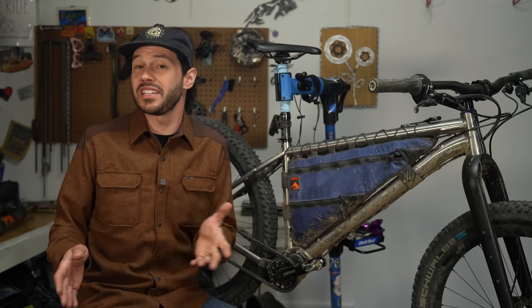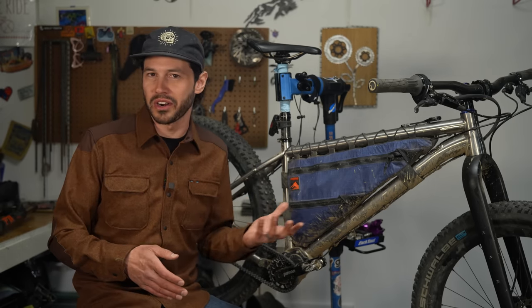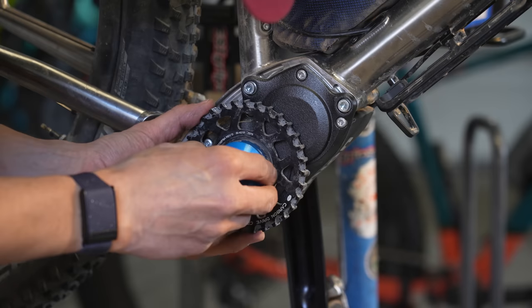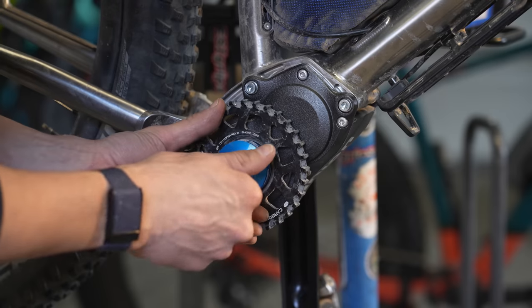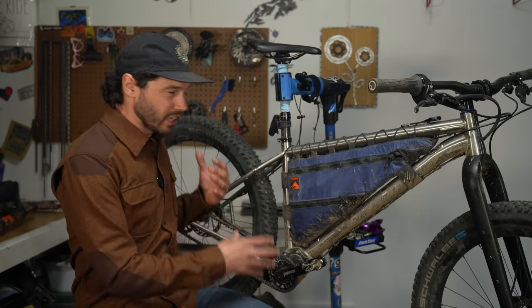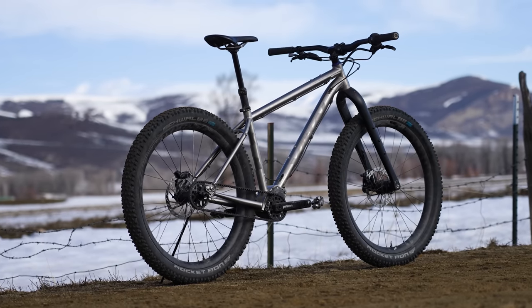When you purchase a bike from Viril, the thing you need to understand is what chainstay length you actually want to run, as it will vary based on tire clearance and the gearing of your pinion. But you are definitely in good hands with Steve, as he's extremely knowledgeable. The shortest chainstay length comes in at 434 millimeters and can be as long as 450.5 millimeters. If I wanted to run that 434 millimeter rear end, all I'd need was an 111 tooth belt, which would allow me to run the bike in the shortest position with 27.5 inch wheels.